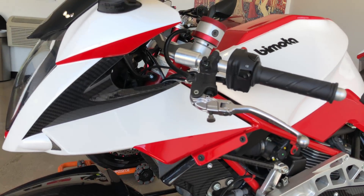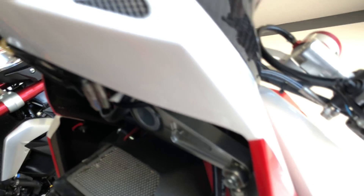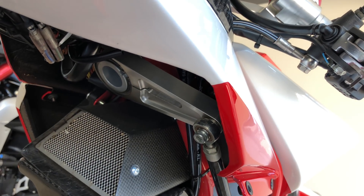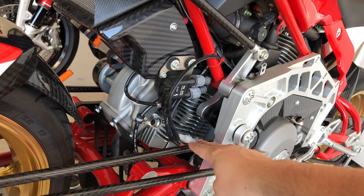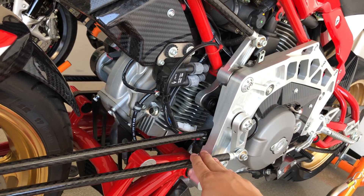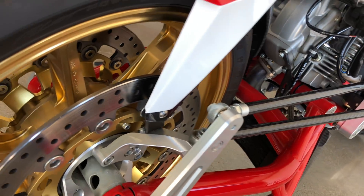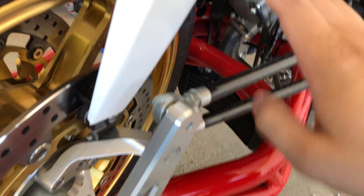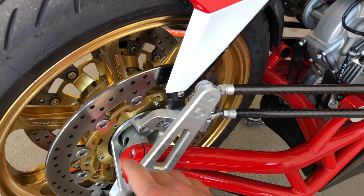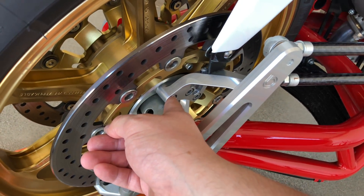Assuming I didn't just lose you, let's go through this again. You've got the triple clamp, and that pivots here, goes all the way down to some crazy plates behind the frame, and then this rod — I'm sorry, I almost pointed at the wrong one — this rod goes in and out, which causes the wheel to pivot. And this rod and this rod over here are only keeping the position of the actual axle, while the wheel can pivot back and forth around it.